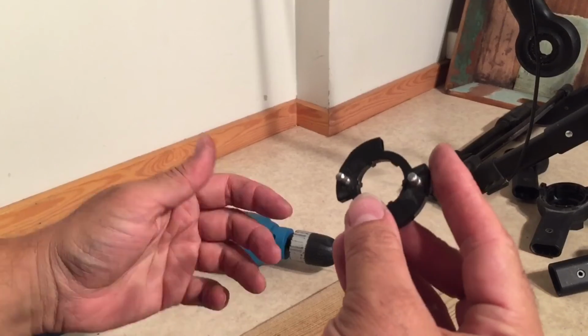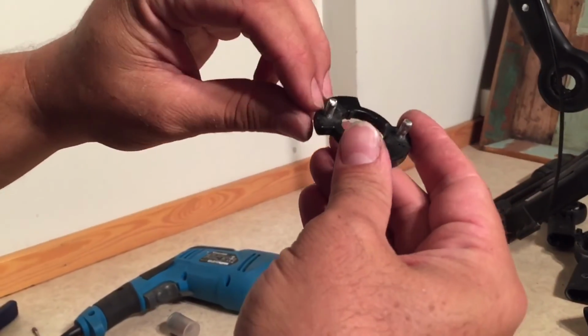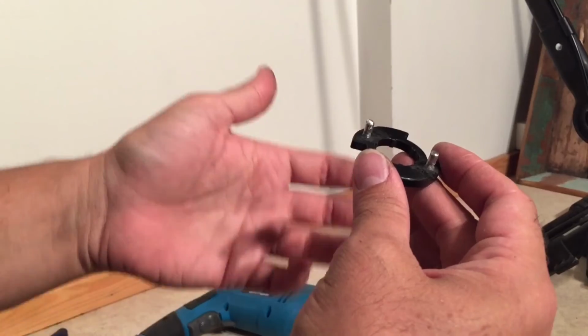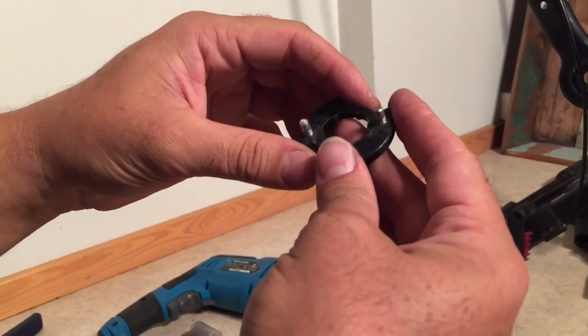So what you can do if you're having trouble getting it all to work, take it out, take it apart again, look at your disc and try to fix small imperfections with a Dremel. It can also simply be that you need to take it apart and put it together a few times to get it to work properly. It's a very fiddly system to align properly.